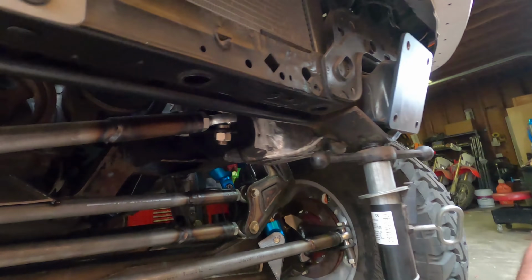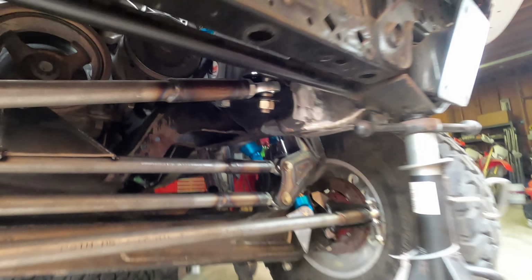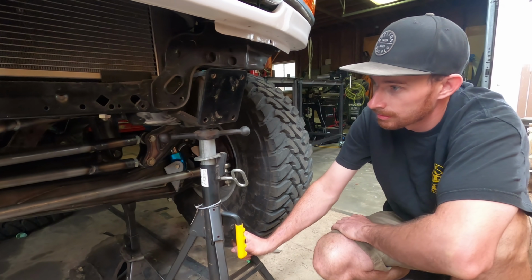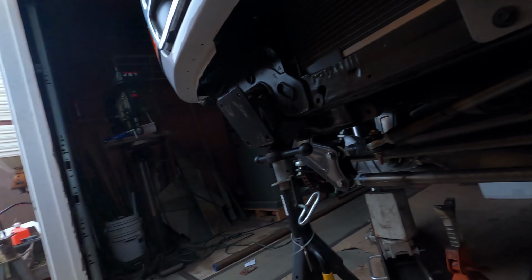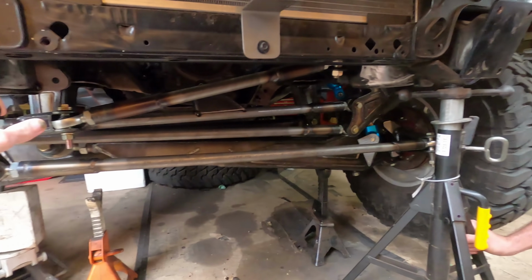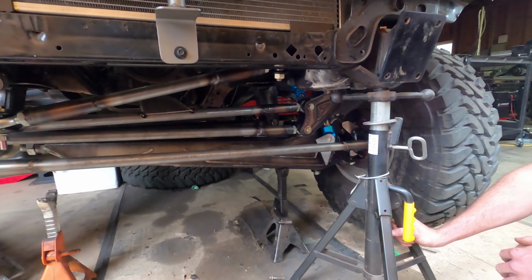The box is all back in. We took that over to Hal and they got the stops put in there. So we get perfect 1.25 turns each way. The important part about putting internal stops in the box is marking it accurately for them to do. So we didn't use a Sharpie or anything like that. We took a scribe and made nice, clean, sharp marks that were not wide at all. That way they have a perfect position to put the stops at. So they got that all in there, no issues there. And now the steering cycles each way, no problem, stops exactly where we wanted it to.